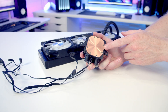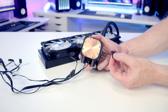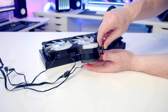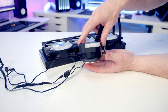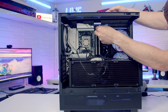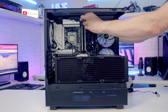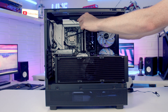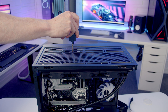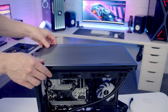If you're using the AIO from new, there'll be thermal paste pre-applied to the cold plate so be careful not to damage it. Take one of the small clips and put it on the underside, then put a thumb screw on loosely on top — same on the other side. Before setting the AIO into the case, plug the CPU fan header in at the top and pass the rest of the cable including the ARGB cable through to the back. Then set the AIO up into place at the top of the case and secure it using the short radiator screws. Replace the dust filter at the top.